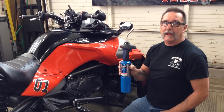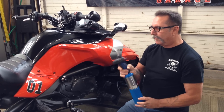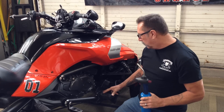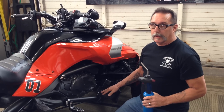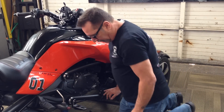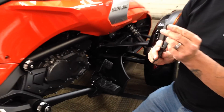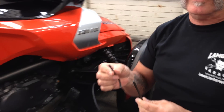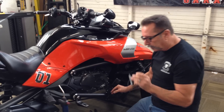If you got a typical propane torch, these run 20-25 bucks at Lowe's or Home Depot. These will work, but the flame is a little bit bigger than what I am going to use, and I recommend pulling the pad off because the residual flame could burn the rubber a little bit. The other thing is, if you use an Allen wrench, this is a number 5 Allen — you do not want to use a ball wrench on it. A ball wrench is bad. You want a square end, something that is going to fit in there tight. This is stainless steel but it is actually pretty soft, so make sure you do not use a ball wrench.